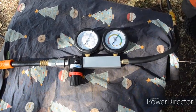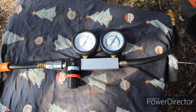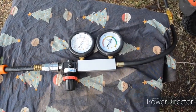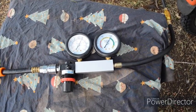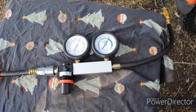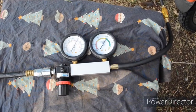The gauge on the right is reading close to 40% — that's way too much leakage. You would want way less than that. No engine is absolutely perfectly sealed; all engines will have some leakage. But close to 40% is way too much, and that's why our compression is down to 145 psi.